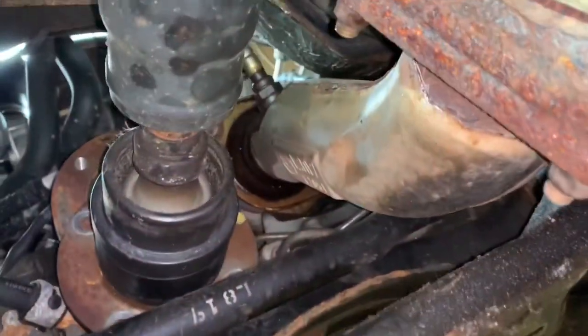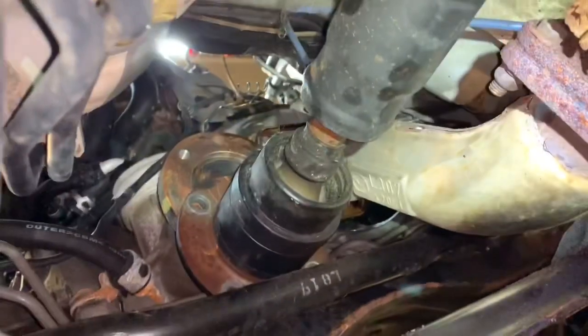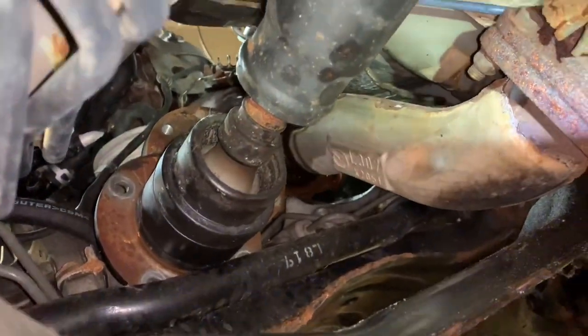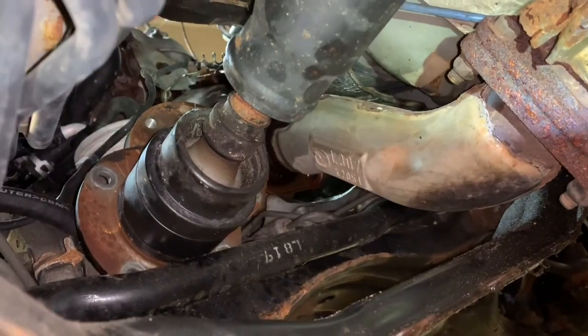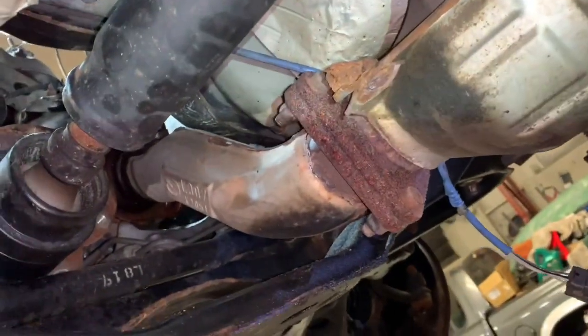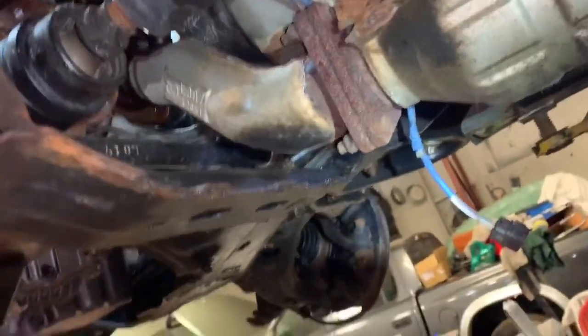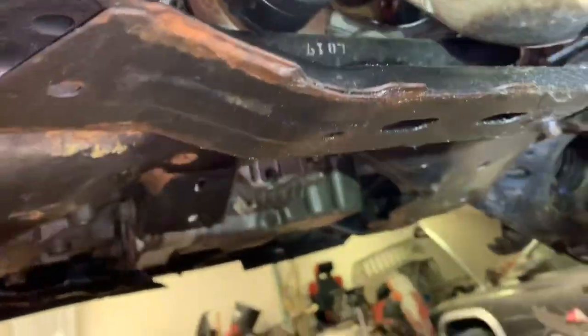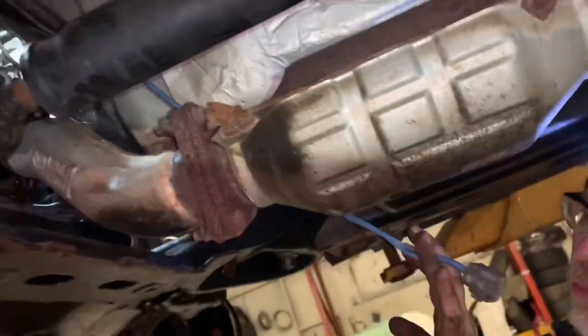I broke that sensor off — that's exactly why I normally don't. We've got the exhaust done up at the clamp, and we've got the rear drive shaft out. What size bolts were those? I believe they were 14mm — use a wobbler. We got that undone, and we're hoping we can just lower the whole cradle down and leave the drive shaft where it is because I don't think it's going to make a difference. Make sure you've unbolted the CV axles down the same road too.